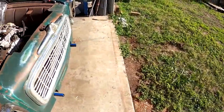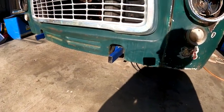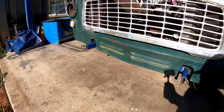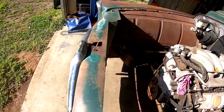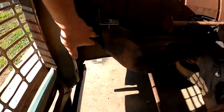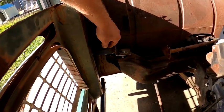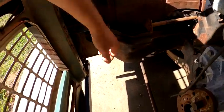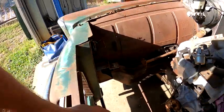And not sure if this was done the other day or not, but I started making the radiator support / bumper bar brackets. Just got that welded up. It's only tacked in position, it's not held in there by anything, but it's just going to live under there. It's tucked in nice under the radiator support. What I'm going to do is, I've got some thick plate going to run from the factory holding bumper bar brackets down and actually pick that up, both sides. Gonna leave these here as a stabilizer as well. The whole radiator support will be supported by that, which will work out really nice.